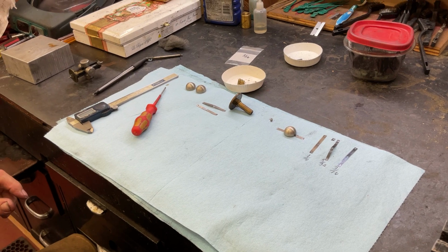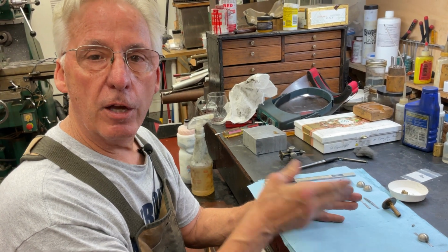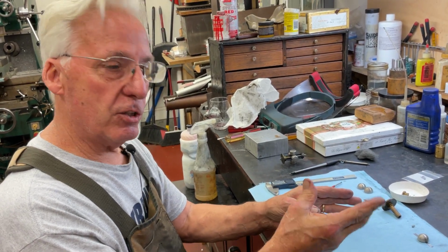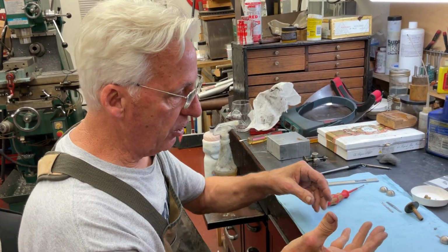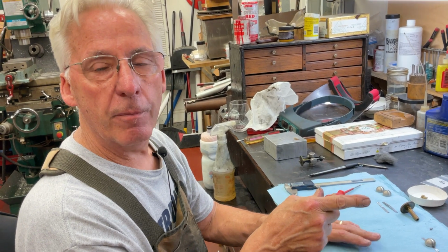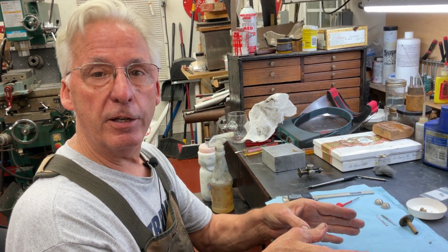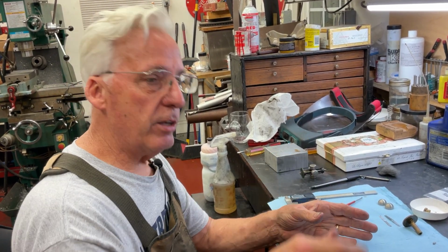So what difference does it make if you have different size springs? What happens is the motor is going to pulsate. The governor is the heart of the motor. And that thing's spinning around doing its job, but we have a loose weight. If we have a loose weight and it starts going like this, it's going to pull the rest of them out. So it's literally going to start bending them down, and you'll see that little bump in the governor, right? And now your motor's going, oh man, I'm having a hard time adjusting the speed. This adjusts the speed, the playing of the record, and then you got it cranked up to run a record of 78, and it's hitting the motor because that weak spring is coming around.